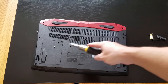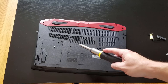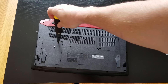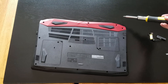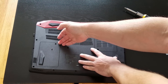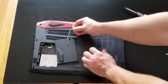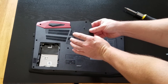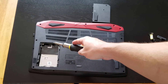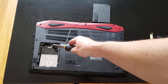There are two access panels on the back — one for the hard drive and one for the memory. They both open up with just one screw, so that's very easy. Just unscrew this panel with the one screw and then pry open the panel from the corner. If you bought the laptop earlier in the year, you might have already had the caddy and the cable, which comes through here.